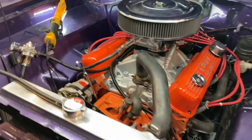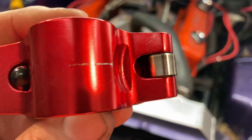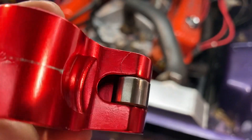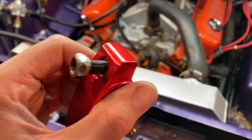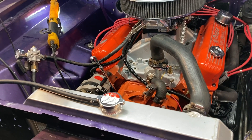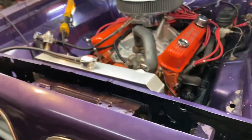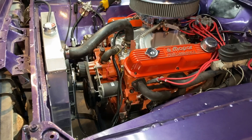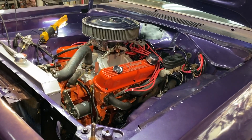She lives! I need to call Mancini though - this is one of their Harlan Sharp rocker arms and I inspected it before I cranked it up. Got a little crack there. It's nice to inspect them before you use them. I had an extra, put it on that side. She starts right up from the seat and sounds a lot better. Rollers are on the stems of the valves now, which is great. I think we've got it solved - just need to get that new rocker arm in and finally hit the road.